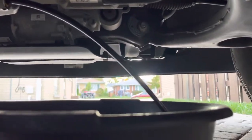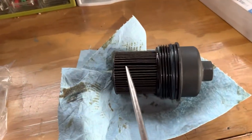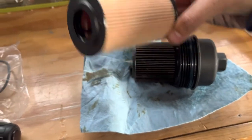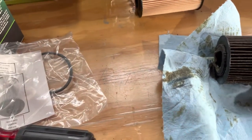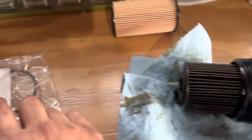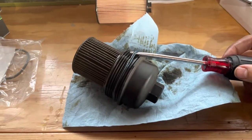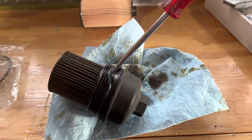We have a free flow — oil draining out. Here's the old filter and the old gasket, and here's your new filter and the new gasket. You need to replace both. The gasket gets compressed over time, and every time you replace it you just replace both. Fortunately the gasket comes with the filter, so this should make it pretty easy. Just take the old gasket out — get a screwdriver, wedge it underneath and pry it out. Pops right out.